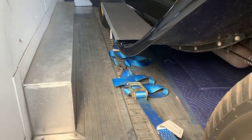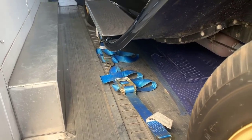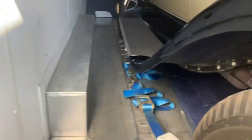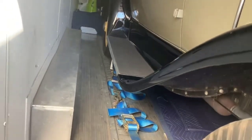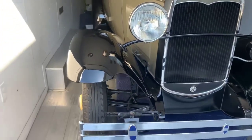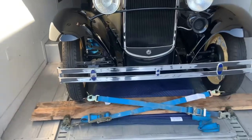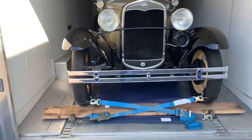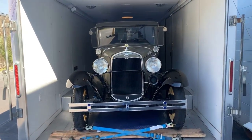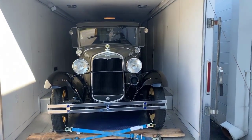I've also got synthetic rope on the rear of the trailer. This vehicle has remained in place for the entire trip out from Kentucky to California. Occasionally I'll check the straps and the winch line, but the key is to keep the vehicle together — tied to the center — not to pull it apart.